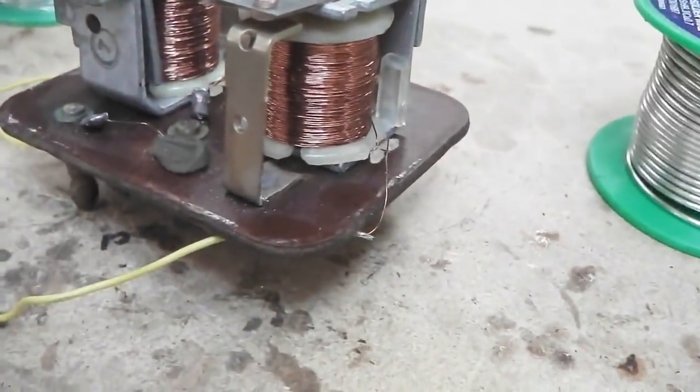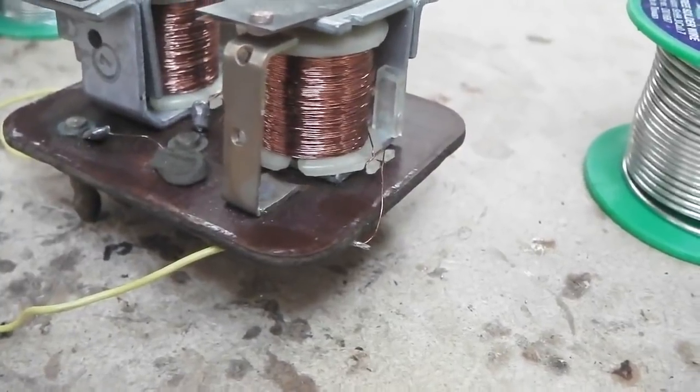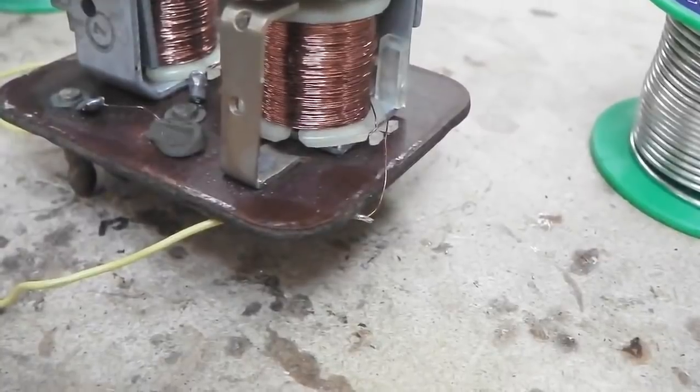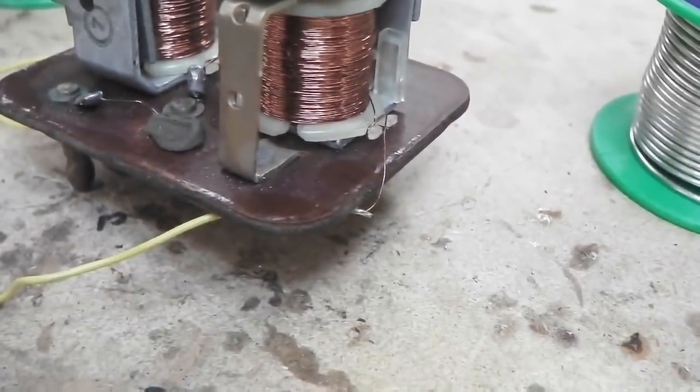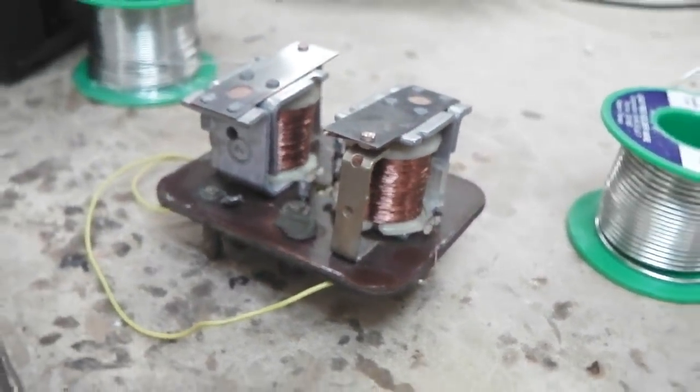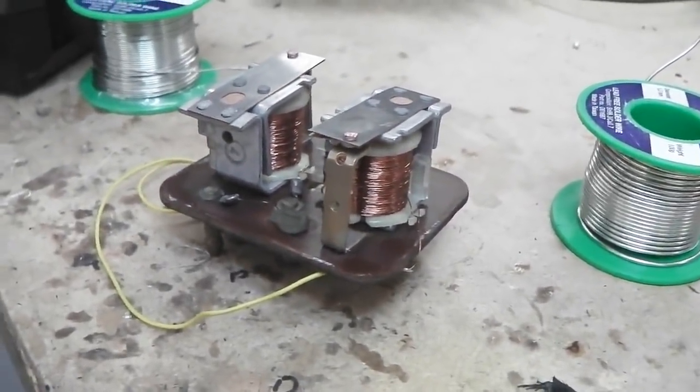There, you can see it a little bit better on that side. So I'm going to take that across, but we'll heat shrink it simply because we've broken into the insulation now, and then we'll glue gun it, because it'll tend to wobble otherwise, and onto that pin. So, repair here for the engine bay mounted headlamp relay as part of this loom job that I'm doing.